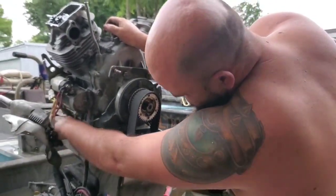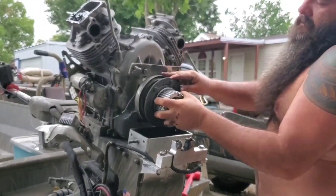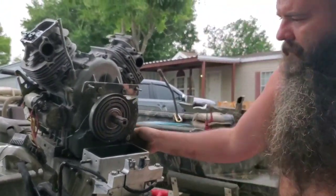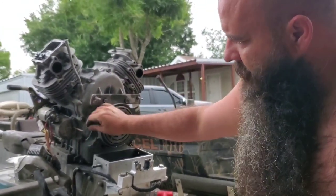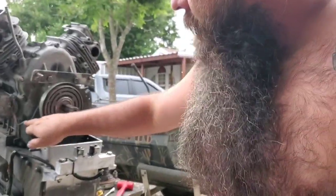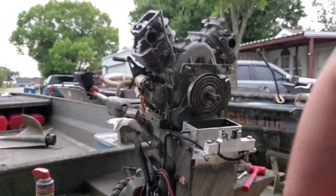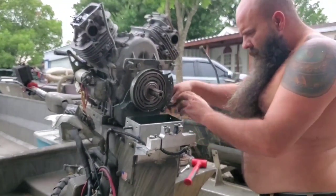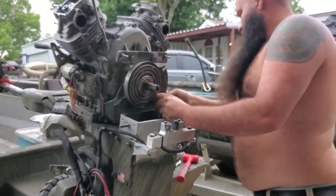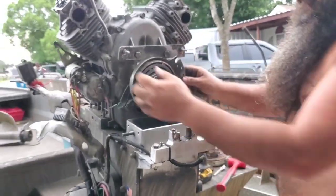Now I've got my nuts off of my engine bolts, so I lean it back and pull the belt off. I pull my belt up and shove it down in case. Now I've got to pull our clutch holder there. You don't have to cut these wires, but look — somebody's messed with this so many times it's not even on the proper ground. It's not supposed to be grounded here, so I don't know if these wires are still good or not. So I cut every one of them so I can double check and see if there's any corrosion. When I work on an engine, I want all new watertight fittings.